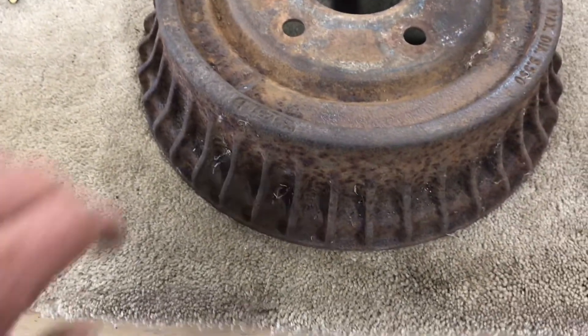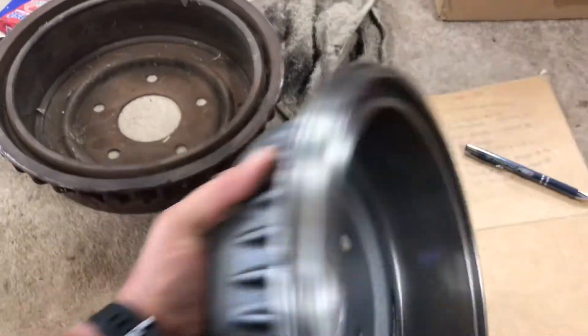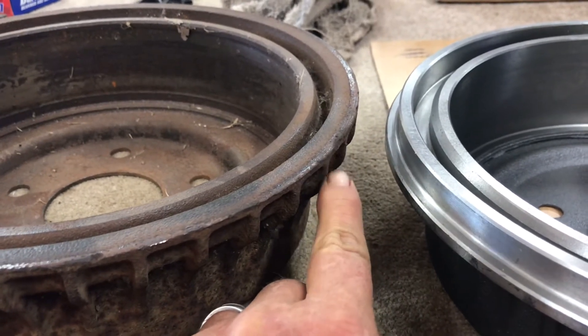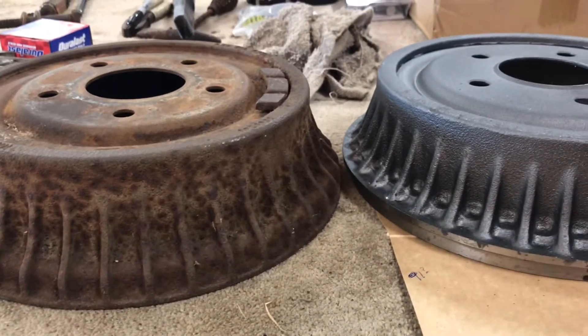Here's a brake drum off the stupid truck, which is an 88. It looks rough because it's been sitting out in the weather for a couple of years. Compare that to one off a 92, which looks clean because it's been sitting on a shelf at AutoZone. What you need to look at is this little lip right here, which does not exist on the 88. So an 88 and a 92 have different brake drums, and the differences are also visible from the side. Those two brake drums are different part numbers — if you try to put the 88 drum on the 92, it's going to scrub and probably create so much heat that it messes up your rear axle seal. Don't ask me how I know that.